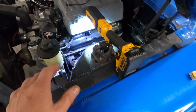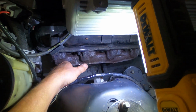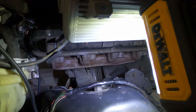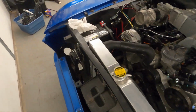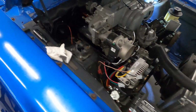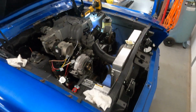So we'll cut the tubes off. We'll move them out about 1 inch because there is clearance. It's not a problem. Then we'll re-weld them, and they won't be pretty at first, but they're gonna be awesome. We'll clean them up and we'll get them re-ceramic coated. And this side's perfect. There's no problems. That side is the tight one, so we'll do what we can do.